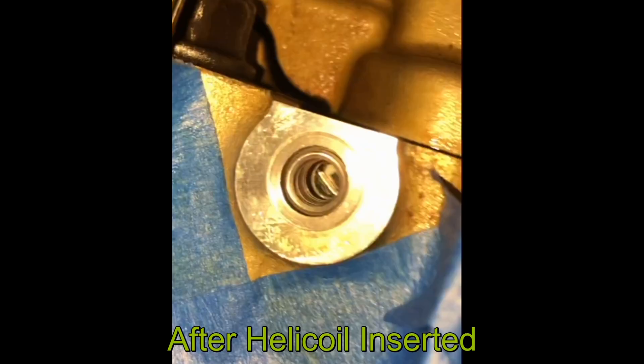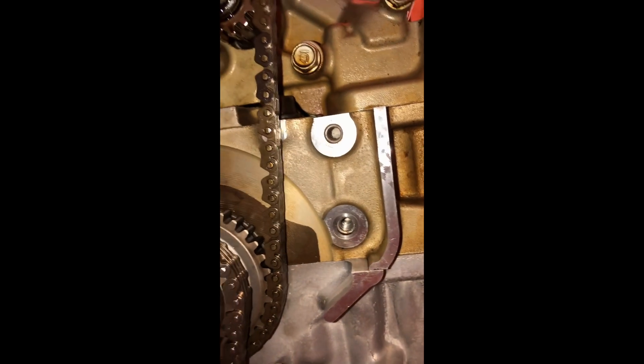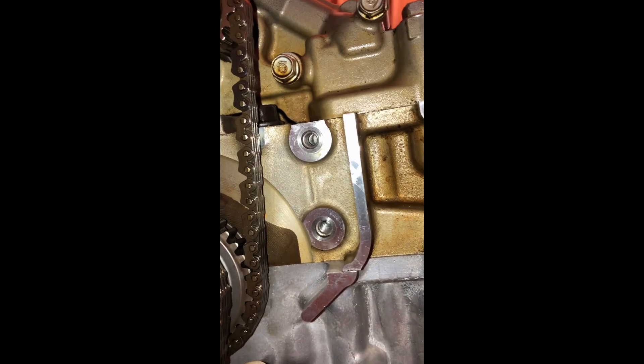It just looks like normal threads in there now. If you look deep enough in here you can see there's that little tang that goes across the hole — that needs to be bent into the hole with this tool. I'm going to position this so it sits across the tang and just tap it in. According to the instructions, the idea is to bend that tang in toward the engine so it doesn't interfere with the bolt going in. Theoretically the hole should be fixed. You can see the helicoil in the top one and regular threads in the bottom one, which still seems to be okay. I'm going to go ahead and install the chain guide, and I do have an inch-pound torque wrench now to make sure I don't torque down too hard.